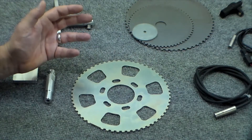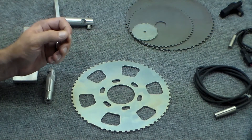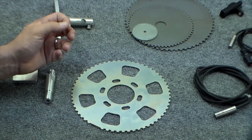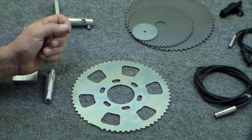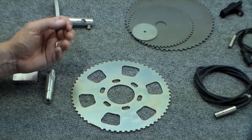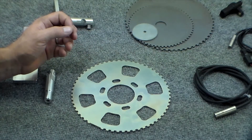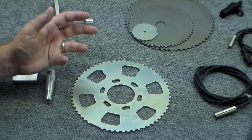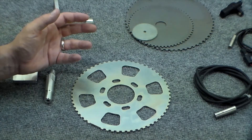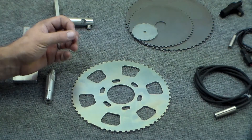Some examples would be vehicles using Bosch Motronic systems, the new GM engines as of 2006, and even Honda, Hyundai, and many other manufacturers that have started to go towards the 60-2 trigger wheel pattern. Those are generally already mounted on the engine, and in those cases you don't really need to do much but hook up to the factory crank position sensor.